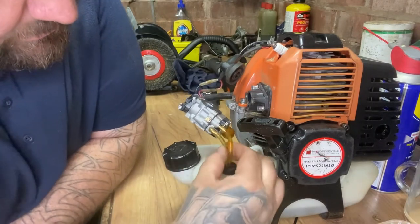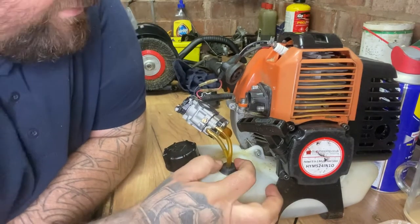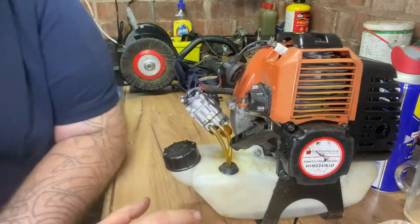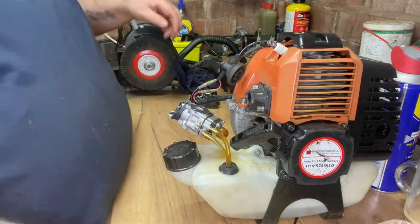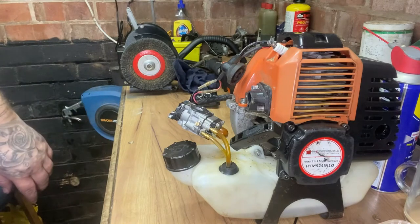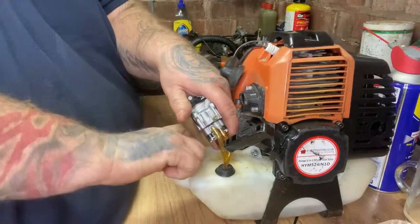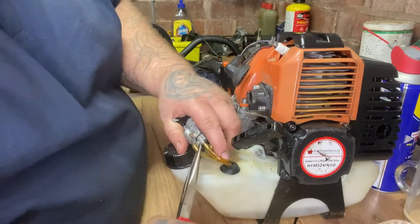So now you've got your fuel in and out - obviously you've got your bung for your fuel tank, you've got the carburetor, and then obviously you've got your throttle at the top. Actually you've got your mixture screw there. What I'm going to do is get a pair of long nose pliers, first release the air out of the tank, and then slowly get the fuel pipes off.